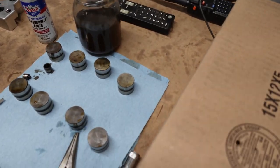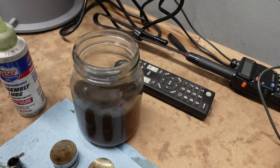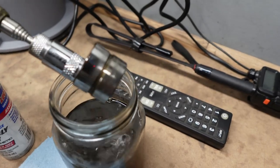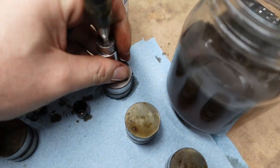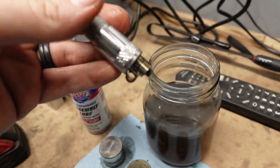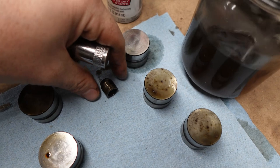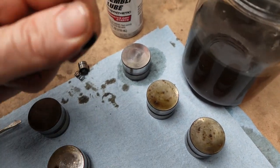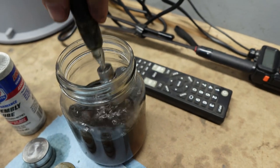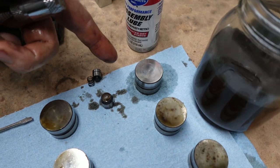Cleaning it is really easy. I take a container with more surface than not, grab the lifter — this is just like 93 or 87 gasoline, whatever — put it in, swish it around a couple times, kind of turn it, shake it, and it'll wash all the crud off. You can see the difference — it washes all the stuff off. Same thing with the little plunger and the spring. I always grab this guy by the flat end so that the open end can get rinsed out. Then I'll dry the four parts off real quick, just dab them off with a shop rag, and then we'll assemble them.